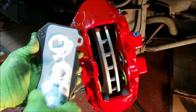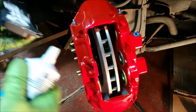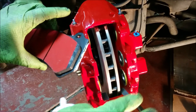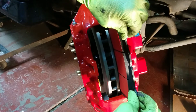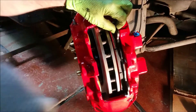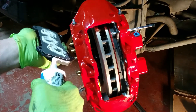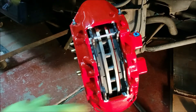I went ahead and put some along here too. I'll try to slide this in keeping the face against the rotor so that grease doesn't just get stuck along the back there and fall down towards the rotor. Go ahead and put a pin in right there just to hold it. I'm not going to drive it in yet, I just want to keep it in place.